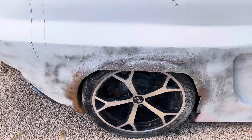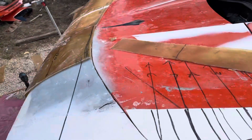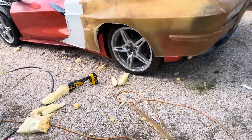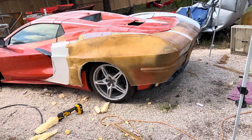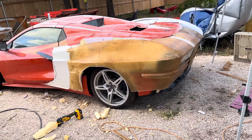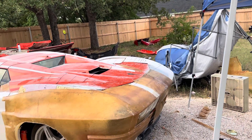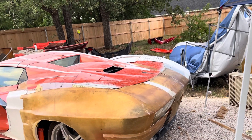I'm going to swap the wheel and tire for the correct one. On the other side, this wheel and tire is the factory one, which is two inches narrower than the ones that are going on it. So that'll move it out — I think it moves it out the whole two inches or at least an inch, I'm not sure which. But that'll allow me to locate that panel in and out. And then the top edge will be located off of the seam between the trunk and the rear hatch opening area.